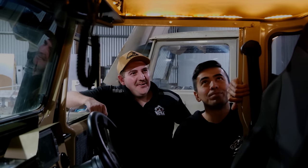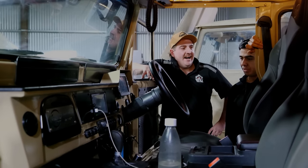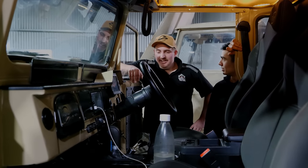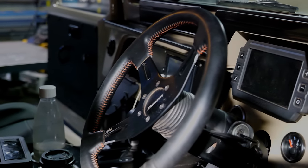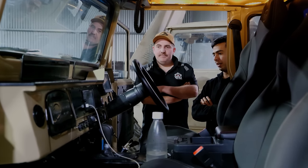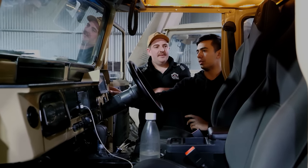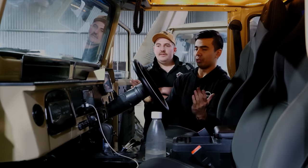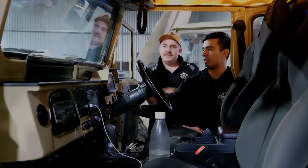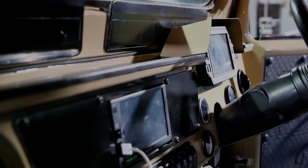I really like this interior — what have you got going on? A little bit of strip lighting — it sets the mood. It didn't come stock from the factory. Similar floor pan kit to mine — it was actually the V1 where we did the development, so you kind of designed the kit in this car, then we did a few more tweaks. Every inch of it has had something done. I like the custom dash — you've got an actual shelf to sit things on. I've brought the dash out 65mm and added a shelf, and I've had to shorten the fascia to get it all to work with the angles because I switched to the newer doors as well. I've doubled in all my rocker switches across.